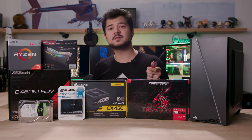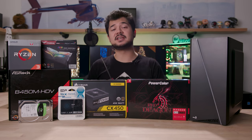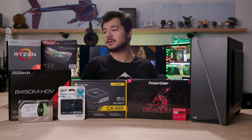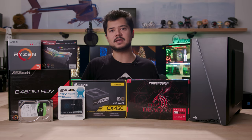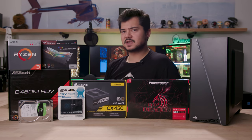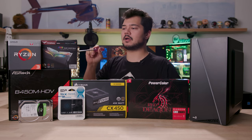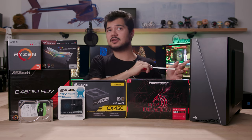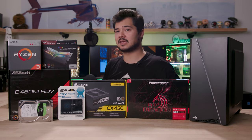The memory we're supposed to be using is a 16 GB dual-channel kit of G.Skill Aegis DDR4 at 2800 MHz. Due to the Christmas rush it's been delayed in shipping, so we have a placeholder: the T-Force Nighthawk RGB running at 3000 MHz, just a bit faster. If the Aegis kit doesn't arrive in time, I'll downclock this kit to 2800 MHz. We did get that Aegis kit for $99, so not too shabby for a dual-channel 16 GB kit.